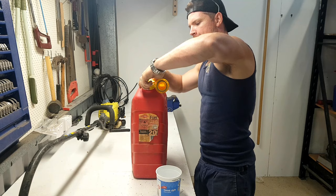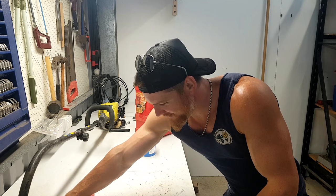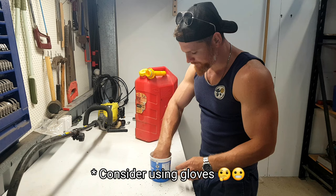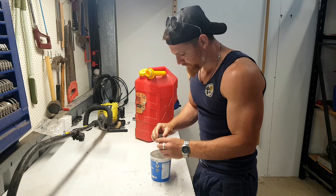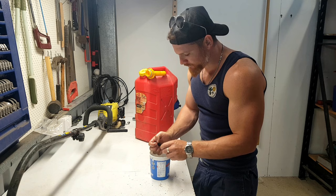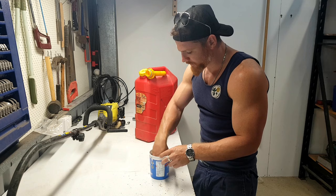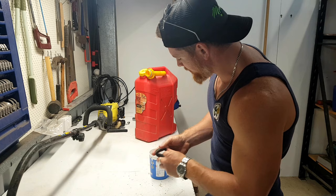Next thing we're going to do is get a little bit of fuel in the container here. We're going to drop that filter in and give it a bit of a squeeze. This one wasn't too bad — I probably could have got away with not worrying about cleaning it. But what's 10 minutes and 30 bucks worth of fuel? These foam filters are generally made to be reused. Unless it's all torn and ratty, you can just dunk it in your fuel, squeeze it out, wring it out and clean it up. If you've got paper filters, you can generally blow them out or throw them out and get new ones. But these ones are made to be reused — and we can see it's not too bad, just cleaned up a treat.